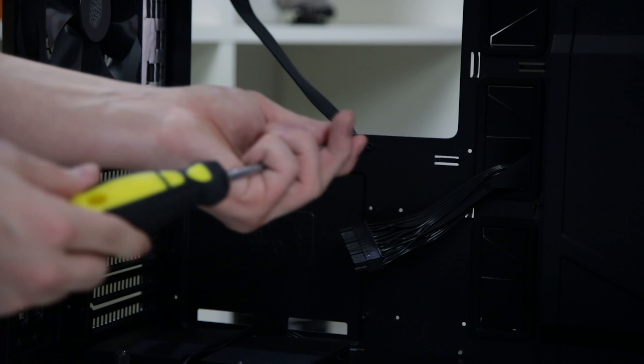The first thing to do after mounting the cooler is connect all the fan cables - on this board there are three headers up top, so plug those in. The CPU cooler sits on top and clips around the stock brackets that come with the motherboard. Next we'll plug in the rest of the wires: the 24-pin, audio connectors, USB headers at the bottom, and all that. The front panel I/O connectors can be a little fiddly - follow your motherboard manual for placement. Some boards come with a quick-connect block, but I'm doing these by hand since I know where they go.